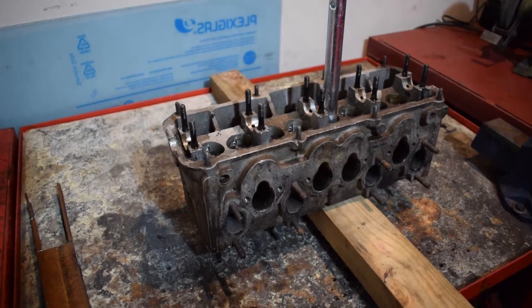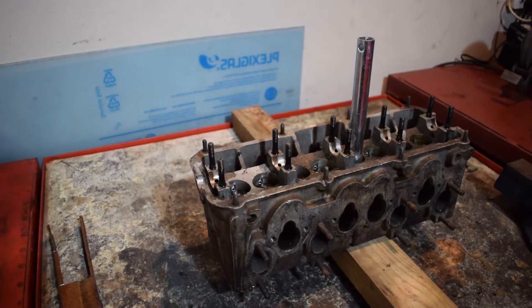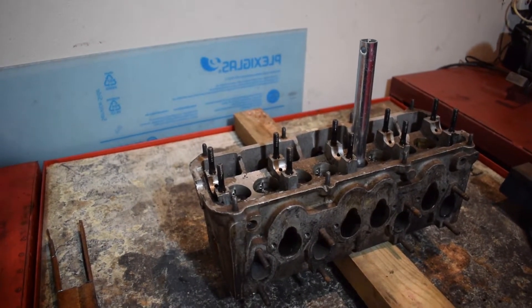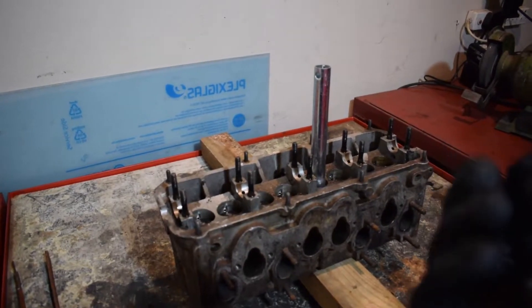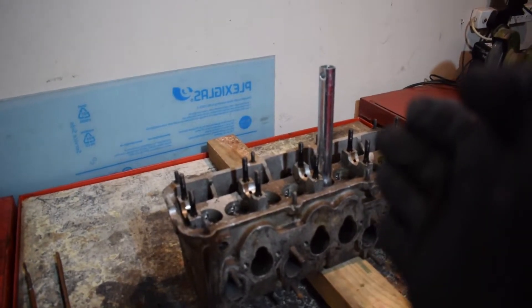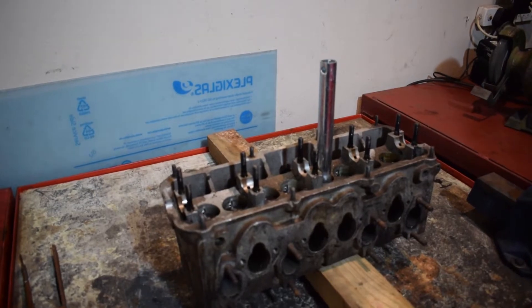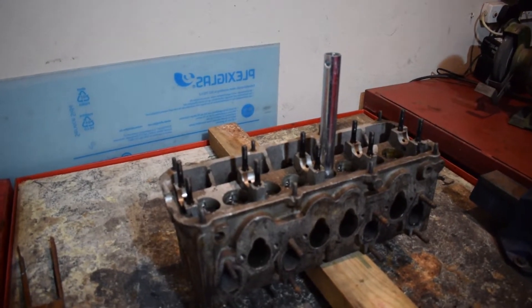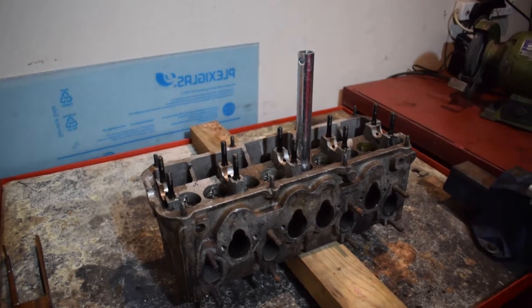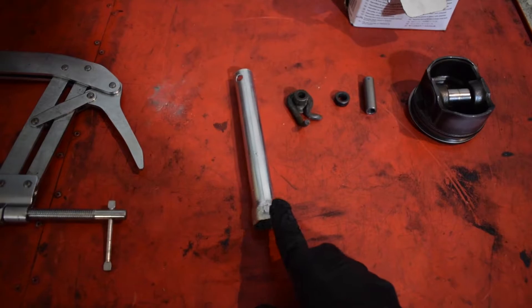It's also not a very quick process with this tool — it's really fiddly. What I want to do is create something that's quick, easy, and effective. It's about efficiency — I want to be able to get through a lot of these valves quite quickly and also safely. When you're placing the cotters inside the retainer and you allow the spring to seat, you don't want the cotters sitting slightly outside of the notch on the valve, as that could cause valve failure. So you want it to be really accurate, quick, and efficient.